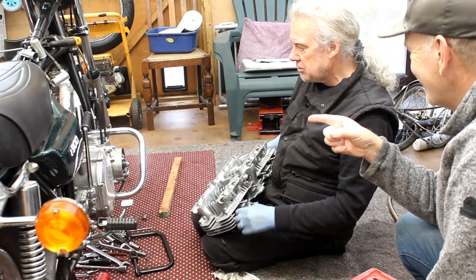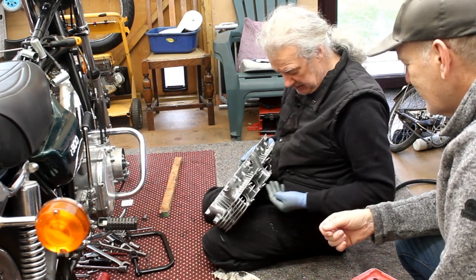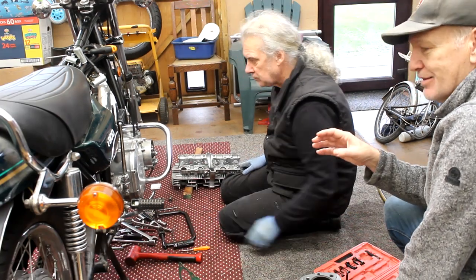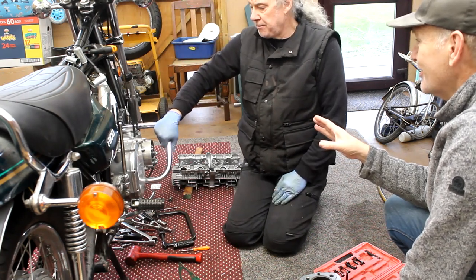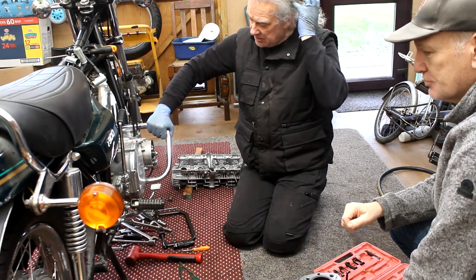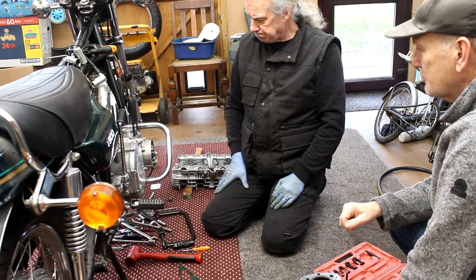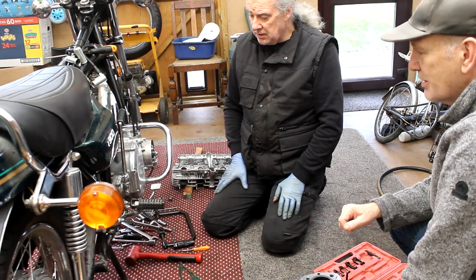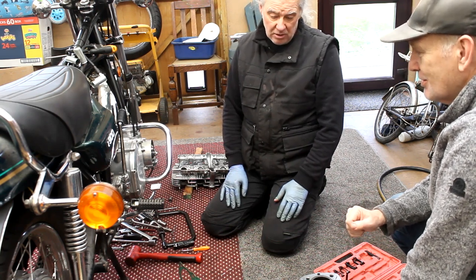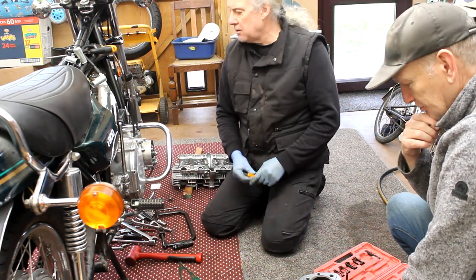The engine looks like it's barely been built at all. I think what's been mistaken for oil has probably been a misfire — petrol and carbon leaking out of the exhaust, because the bores are new. It says it's done 16 miles. It's another nice-looking Z900 on the outside, but not so well on the inside. The original speedo had 85,000 on it. The engine's been apart, had a new cam chain fitted, and there's damage to the crankcase at the front that's been welded. I've stripped the barrel off and found a fault on the number three piston.